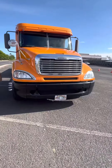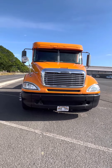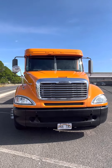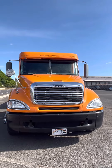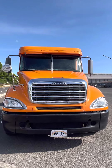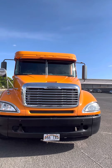This is the front of the truck. On the top over here you have your visor, and you get your five lights up there. Those are your clearance, ID, and parking lights — they should be amber in color, no moisture, no condensation, making sure they're securely mounted and fastened to the truck.